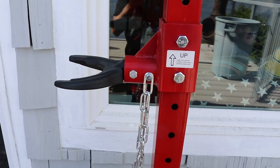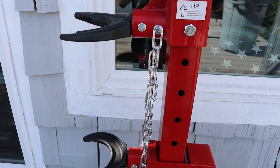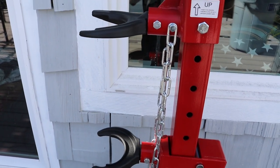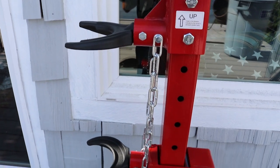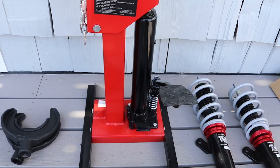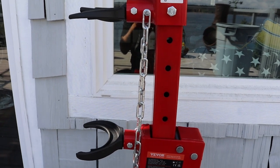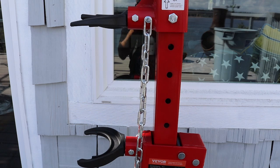What I really like about this is it has a safety chain. So when you mount the struts in between the clamps with the springs installed, you can run that chain around the spring, and then use hydraulic pressure by stepping on the hydraulic ram pump to compress the springs in between the two clamps. So it's a bit safer than the Widowmaker ones they sell on Amazon for around $50.